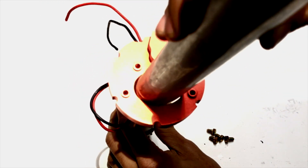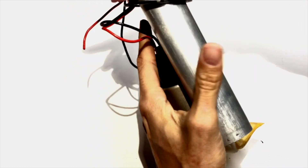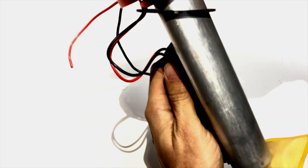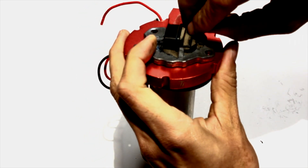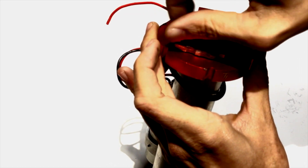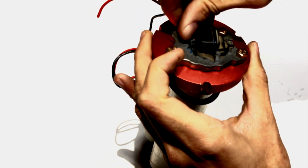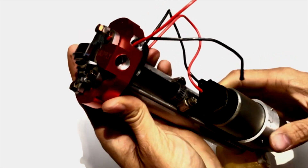You have your wires in, so you're ready to install. Your fuel sender slides right in, and you should be on your way. Here's your unit — you have a couple screws for your fuel sender. Go ahead and tighten those up.